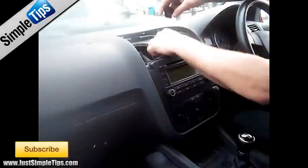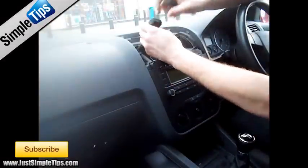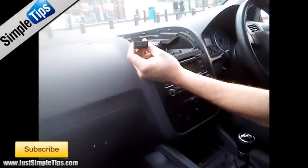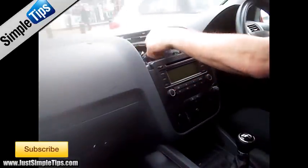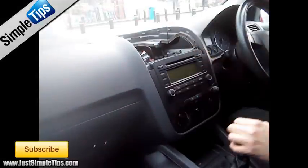You need to plug this back into the wiring loom. If you turn the ignition on without this piece plugged in, you will throw up a warning light on the dashboard for the air bags, and you will have to have this reset at a dealer or a garage that has the tools to talk to the computer.